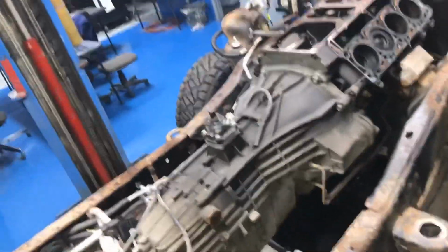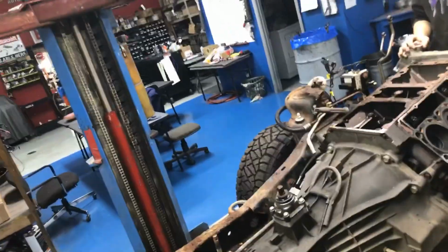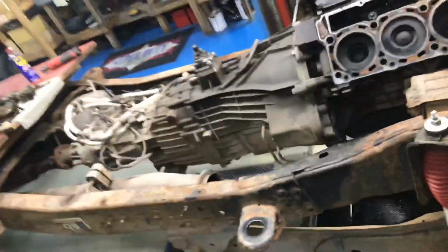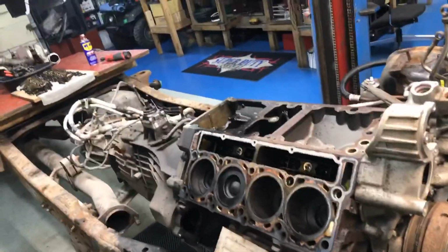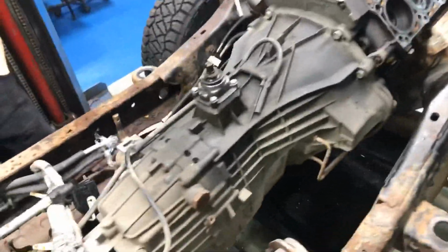I'm not sure, okay, it's been, hell, I don't even remember the last time I did a 6.4 manual. The slave cylinder on a 6-liter, from the history of what I've seen, is a one-time use thing. You pull that slave cylinder out of the transmission case, I mean, it's done. Go buy a new slave cylinder. We're going to go ahead, I think, maybe, I don't know, if we gamble that this slave cylinder will survive, but I can tell you for a fact on the 6 liters, it does not survive. If you're going to pull that out of there and you're going to do a cab off on a manual transmission, you buy a slave cylinder assembly. Otherwise you're going to fight like hell just trying to get it to bleed back up, and most of the time it won't bleed up anyways.